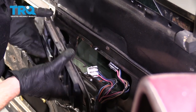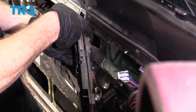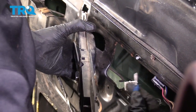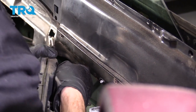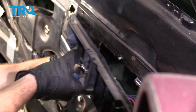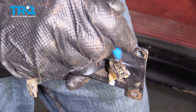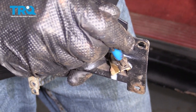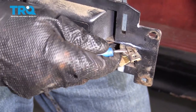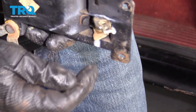The other rod is going to be a little bit harder to get to. I'm just going to go ahead and give this a little tug, and now we can see where the handle rod is. This one's a little bit different — it has a little lock on it. Let's use our flathead screwdriver. I'm going to carefully lift up on this little piston right there, and that'll unlock it so I can slide it. Once the lock is slid, we can remove the rod. I just went ahead and got underneath this area, unlocked it, slid the lock out of the way, then popped the rod up and out of there.